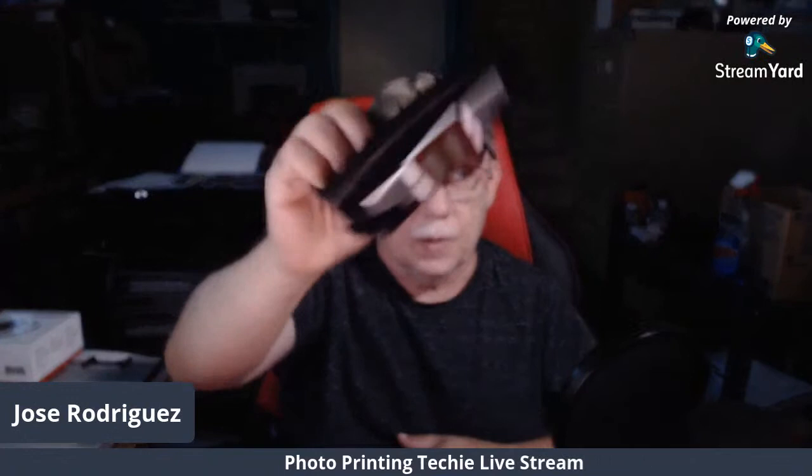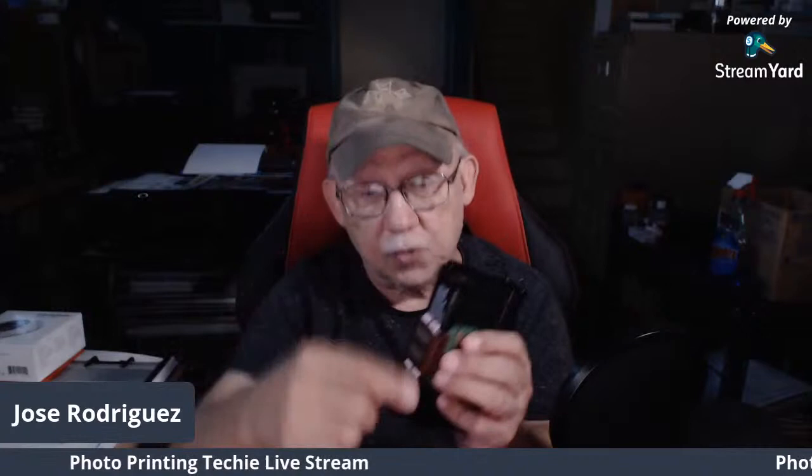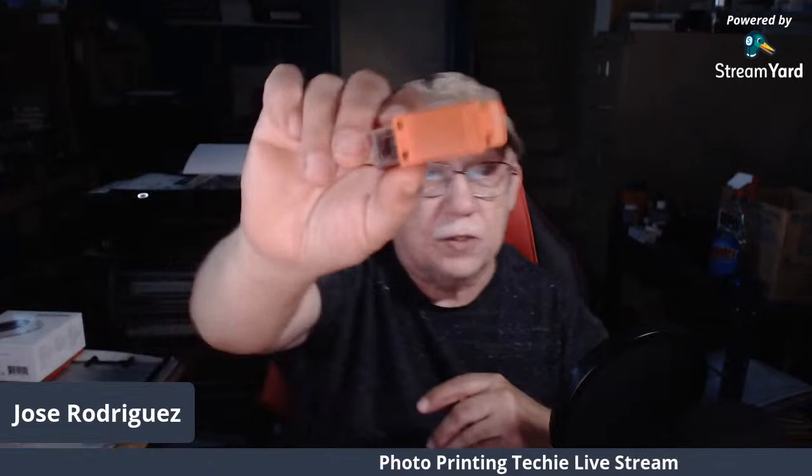prop right here, 9500 Mark II printhead. So the capping station is where this portion, this nozzle plate, if you will, sits on top when the printer is not operating. It just got done printing, it's done, and it parks itself. And it seals against that capping station. It's the same thing as the seals in these printers. These seals have to seal.